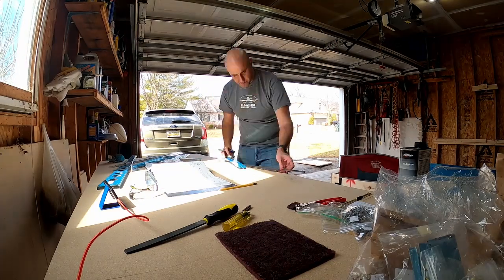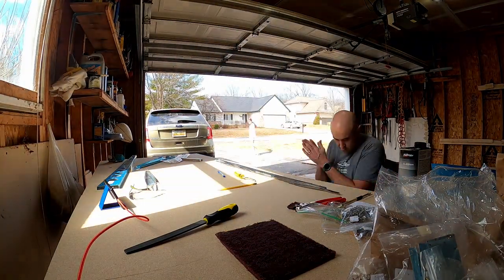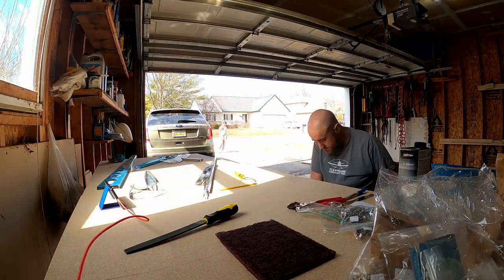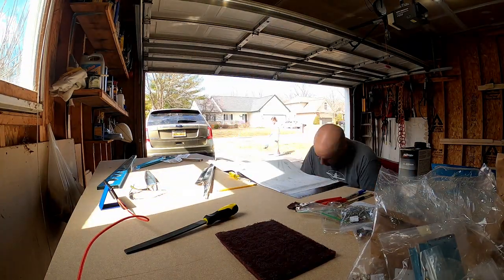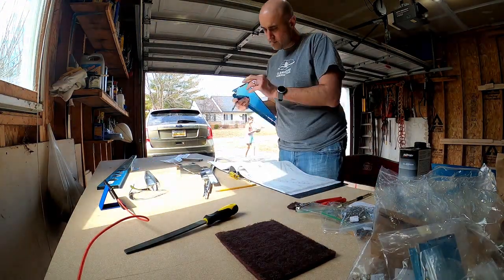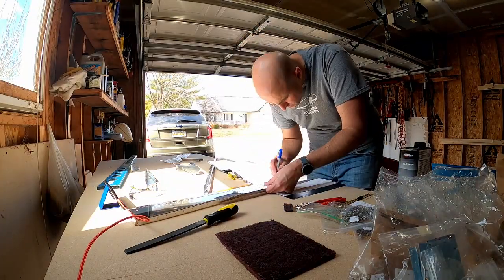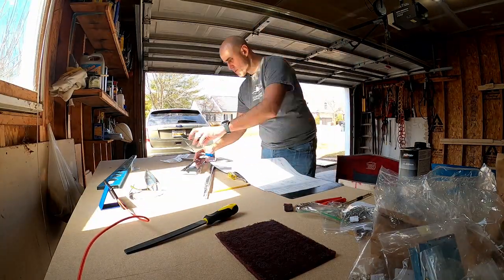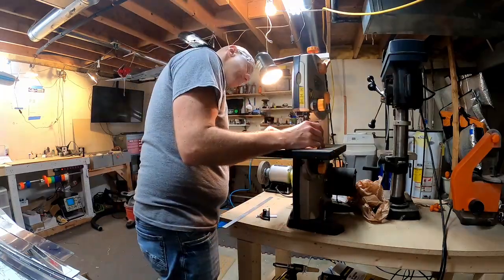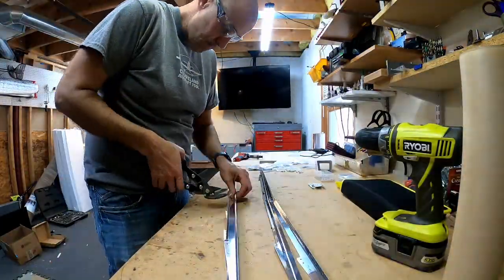It's fine, and many people don't prime. I just decided that for the pieces I can't really inspect very well later in the aircraft's life, I would use some primer. The rudder is nearly complete at this point outside of this video, and I used almost an entire can of that self-etching primer for the rudder, so maybe I want a lighter touch on it in the future.